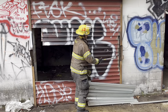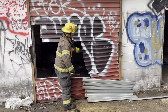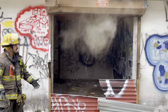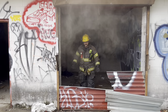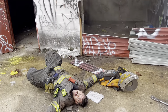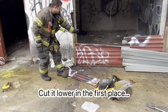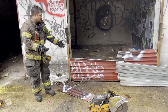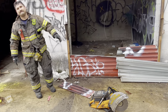I don't need to re-spike this — I've got somewhere to grab over here. Grab with your hands. And now your guys are in — step over. Is it a tripping hazard for egress? You can still get out. If you want to make this cut better, take an extra second and cut a little lower — all the way to the bottom if you like. This is enough for guys to get in and for ventilation to be effective.